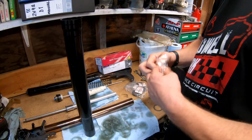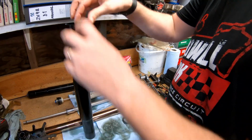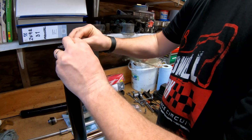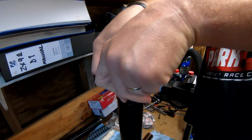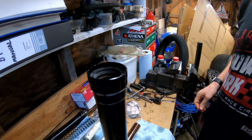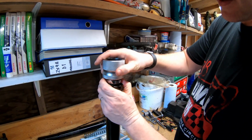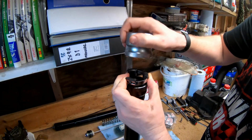Right then, first things first. One oil seal, spacer ring goes underneath the oil seal. And let's just pop that in there. There we go, right. I've got a special seal driver. I'll go and grab it, give it a little tap in to seat it in place. Okay, I'm going to use this largely unconventionally. Just tap the seal all the way around.